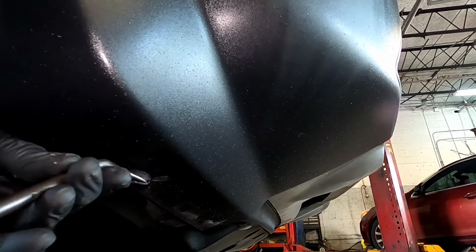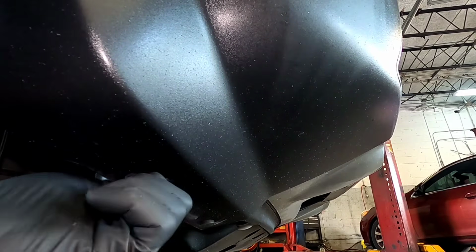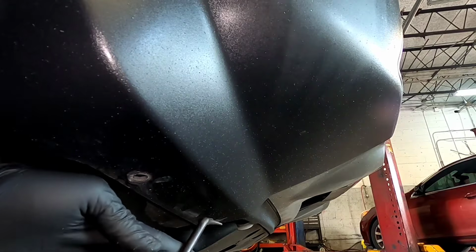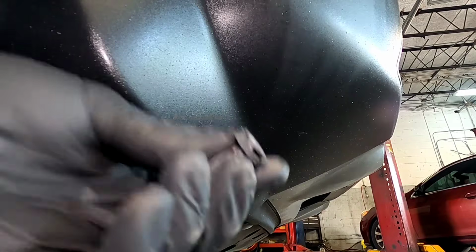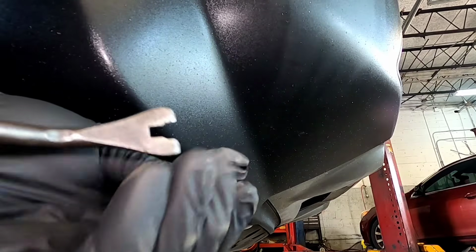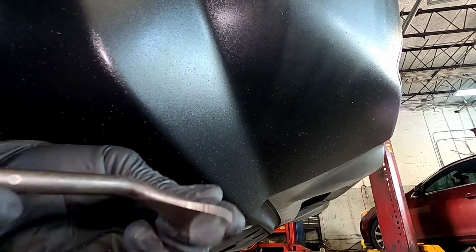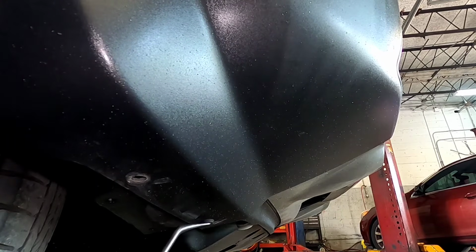So you just want to get in there with your clip puller. Link will be in the description for it also. You want to remove these 2 clips right here. Get in here, get underneath it a little bit, and then get the rest under there like that, then pull back on it. Because there's a lot of dirt, you might want to rock it side to side till it comes out. It's the same thing for this side.